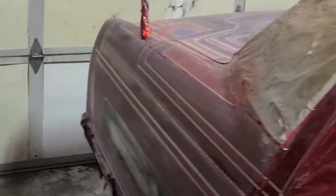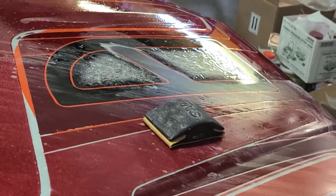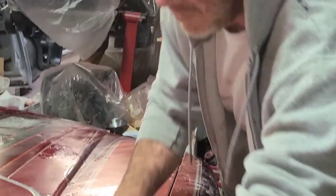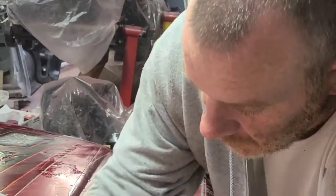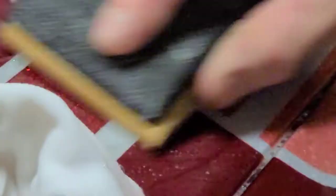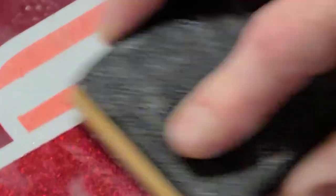There's the foul mouth again. So I still have to tighten that up. But let's bring you up here and show you a little bit of how I do this. A lot of guys are doing this with DAs and whatnot, which is acceptable. But I just like to get a little bit more personal with the stuff I'm painting. Most of the time you'd like to try to go at a 45-degree angle, and I'm using 500 grit paper here.